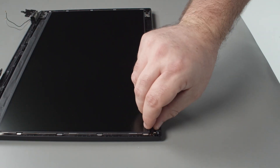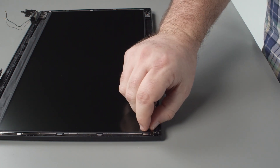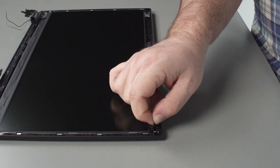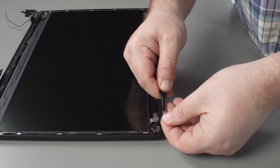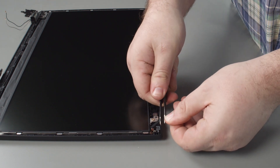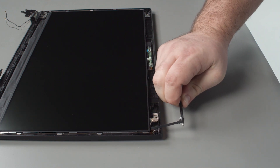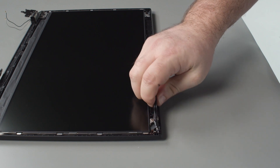Let's replace some adhesive tape. Once you've located the tabs, you can use your fingers to pull the tape out a little bit to give yourself enough slack to begin wrapping it around a pair of tweezers. Once you've got some tape wrapped around the tweezers, you can pull the tape out a few inches and then gather the slack by rolling it up in the tweezers.